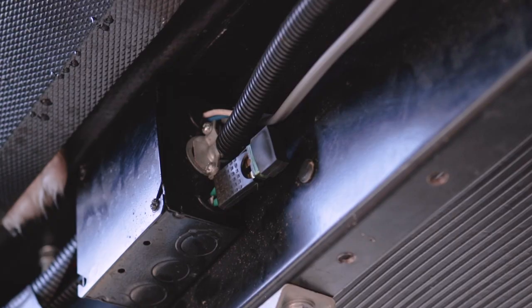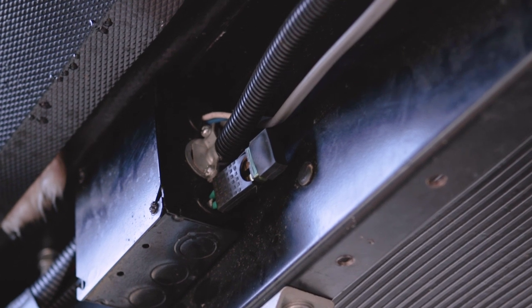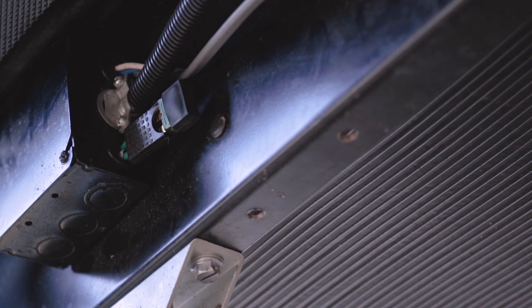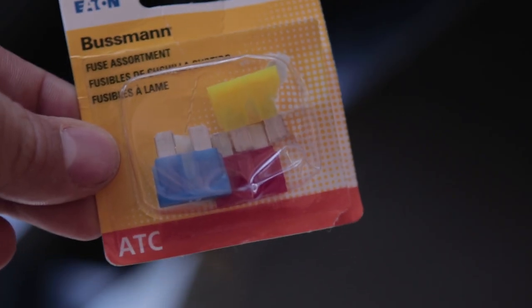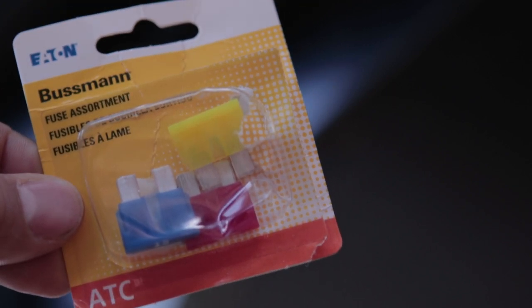Here's the offending issue — you can see this little fuse right there coming out of the distribution box as the power goes into the trailer and back to the converter. The wiring comes off the batteries up here, runs down alongside the frame — that's our solar on the side plug — then it runs up into this little shunt-looking ground-type setup, and then from there into this distribution box. Anytime we weren't connected to shore power and I went to put my jack down, I would be popping that fuse. We went through like four or five different 30-amp fuses because that thing just kept popping.